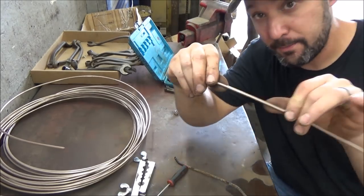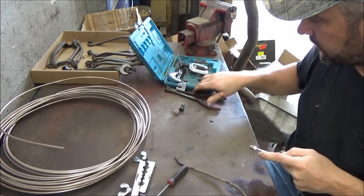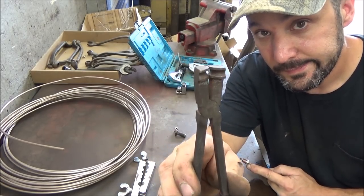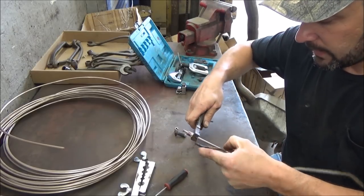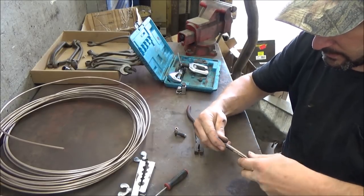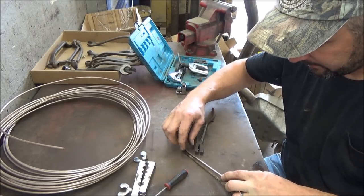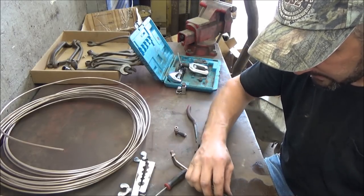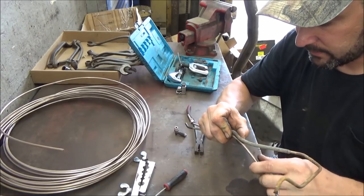This stuff bends — you can bend it with your thumbs, quite easily. So you can do as good a job as you'd like. I've got these pliers that will accept a 3/16th line. I've got tons of different benders. What I'll do is just take the old line, because we've got it here, and mimic what we have. I'll use the pliers there to bend the bends that are somewhat difficult, if there are any. Otherwise, we'll just use our thumbs and kind of go along and make this line up as best we can. It doesn't have to be perfect.